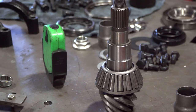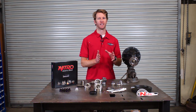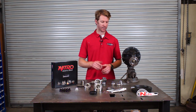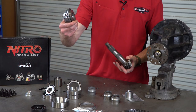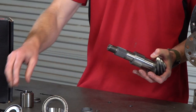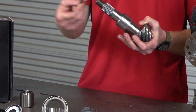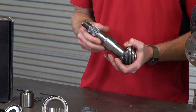It's a very reliable way. It's a little more time intensive to set up because it requires a few steps of guess, check, and repeat. But what ends up happening is the inner pinion bearing goes on, your solid spacer goes on, and then you are setting the depth with your shims. This is going to set your depth and your preload.